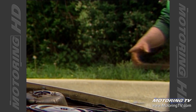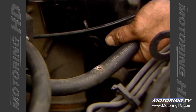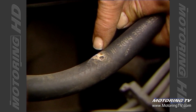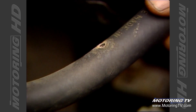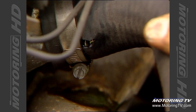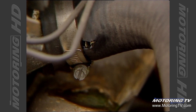This particular car was in the shop last week with a stalling complaint, and while we were in the process of checking that out and test running the engine, we noticed a couple of stains in critical areas. There was one on the inlet heater hose and another stain on the exhaust crossover pipe right below the upper rad hose. Closer inspection revealed that both those hoses had flaws. The heater hose had a little pore in it with a stain around that area and a real slow leak, and the upper rad hose was split as a result of corrosion on the nipple where that hose goes onto the engine — it had actually stretched the hose so tight in that one area that it had started to cause the hose to fray and burst.